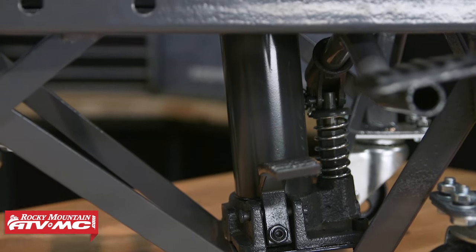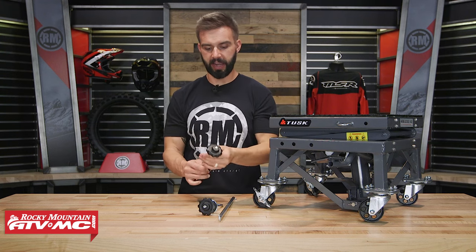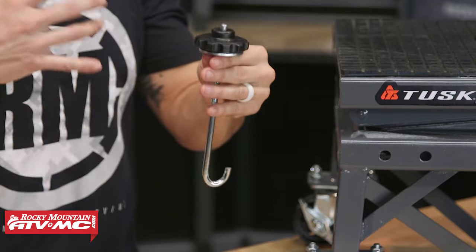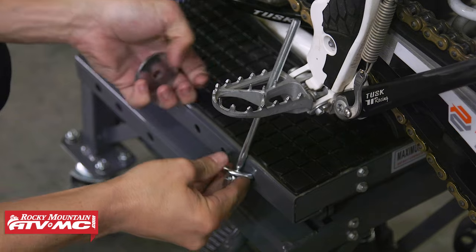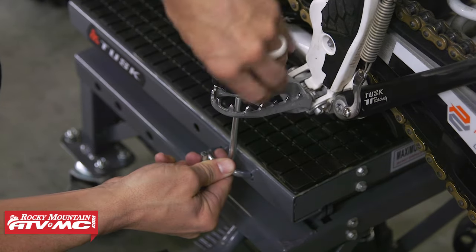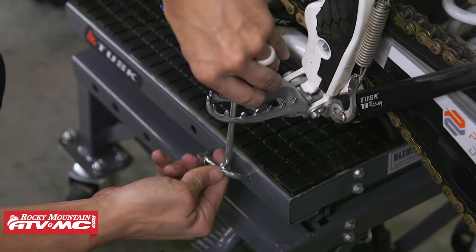You've got a pedal over here on the side. You put your bike on here, and you'll notice on the table you have these hooks. These are actually going to go on the foot peg to secure it in place, just to add some more stability and security to the bike when it's on the stand. These are really simple — you undo the knob, slide it right through this hook on the side of the stand, put it through the foot peg, and then secure the fastening knob and the washer back down on top of the foot peg. That's going to help keep it secure and hold it in place.